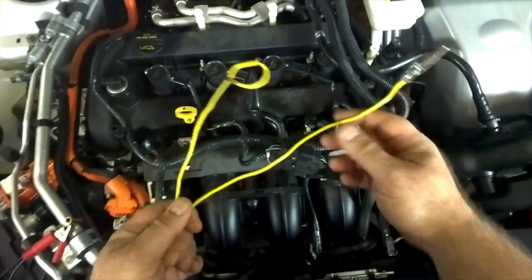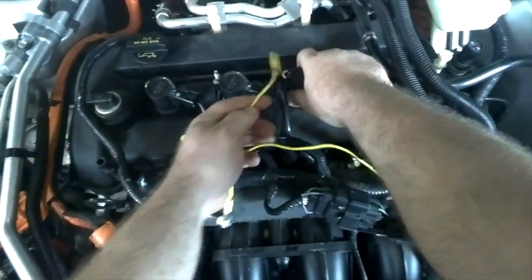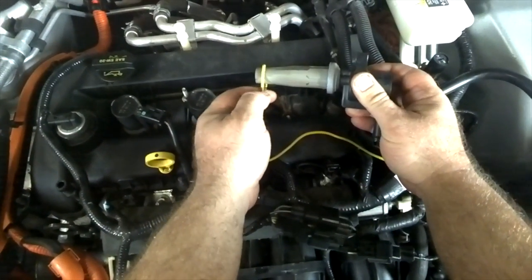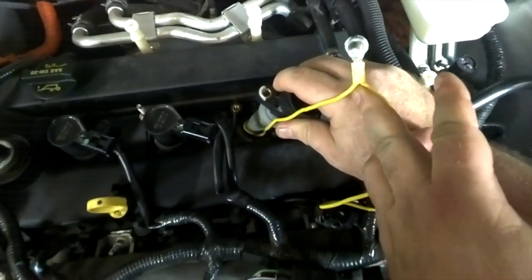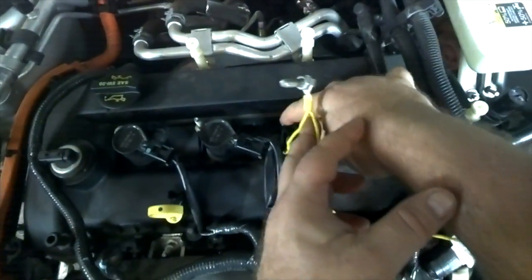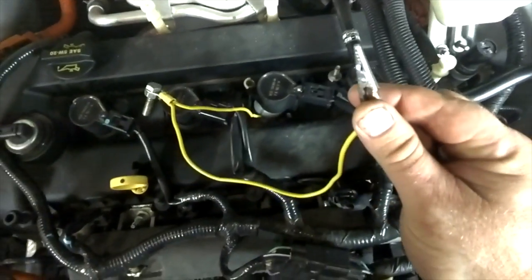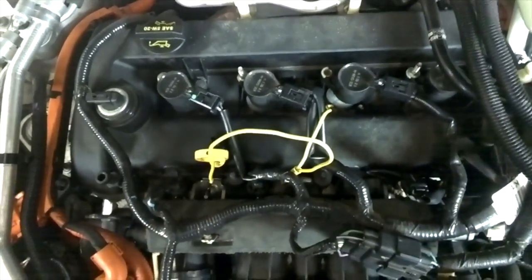So we're back with the vehicle, and we're going to install this loop that I made. I've already loosened this bolt right here — it makes it a lot easier. Just like I demonstrated before, we're going to take this coil and loop the bottom of this right around the bottom of the coil. Reinstall that in the motor, as you can see. I'm not going to put the bolt in at this time, but I don't want to crimp it too much. I'm going to make sure that we take this ground and ground it somewhere — I'm going to take a bolt on the motor and ground that.